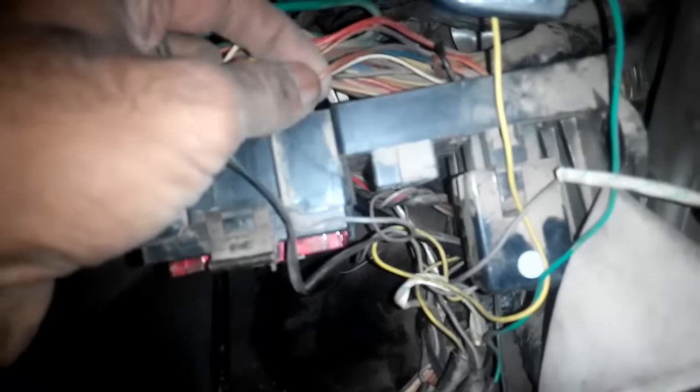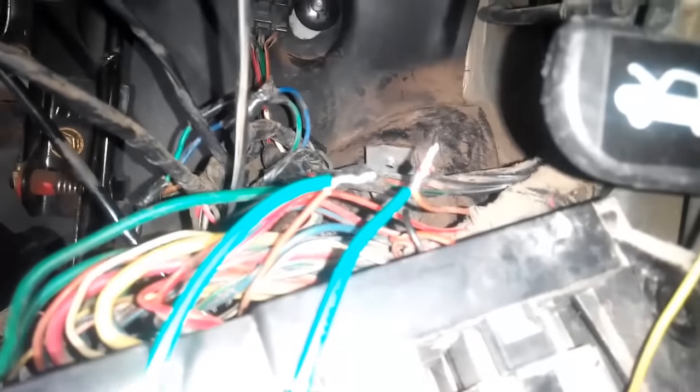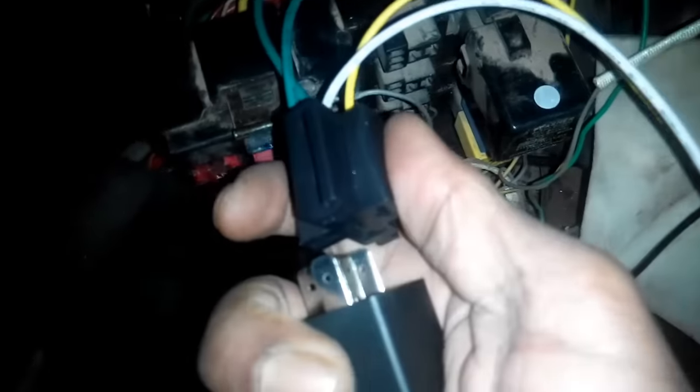I will put a cut in the wire, seal it properly, then pull these wires up to the dashboard meter panel where I wish to install the hidden GPS. Using the multimeter I was able to identify the battery positive connector for the ECU. I took out the fuse and put a cut in the ECU line, then attached the relay supplied with the GPS tracker. To test, I removed the relay and the car stalled, confirming the wiring is correct.